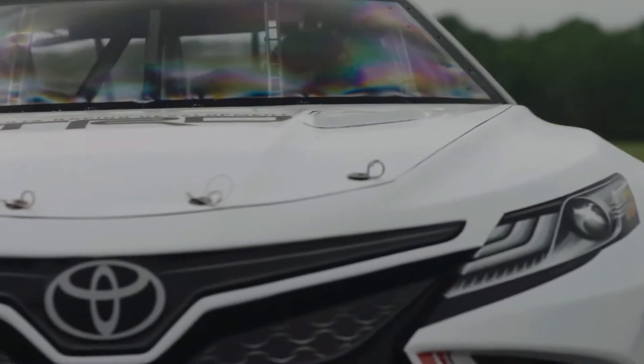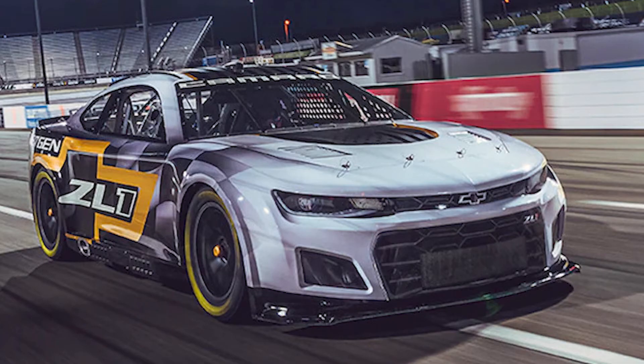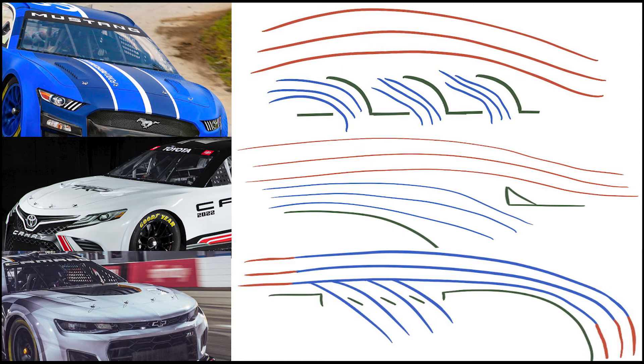There are also vents on the bonnet to help get air out of the engine bay, and these are one of the few areas free for manufacturers to make modifications. Now for a vent to work, the air above it needs to be at a lower pressure than the air below it — air always wants to move from high pressure to low pressure. So to make the vent work you want to create a low pressure area in some way. Ford does this by using backward scoops: the air is forced over the scoop and creates a wake area that the air vented out of the engine bay can get into. The Camry in a similar way has an extrusion to force air upwards and over to create a pocket of low pressure air that can be vented into. The Camaro meanwhile does without either of these and uses some turning vanes to help direct the air out.